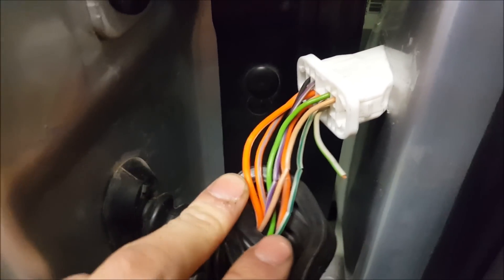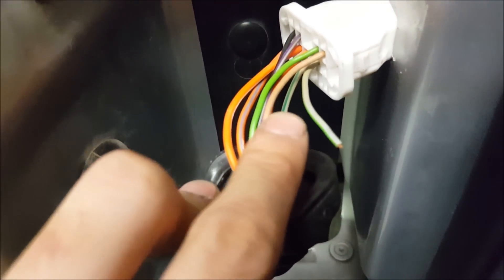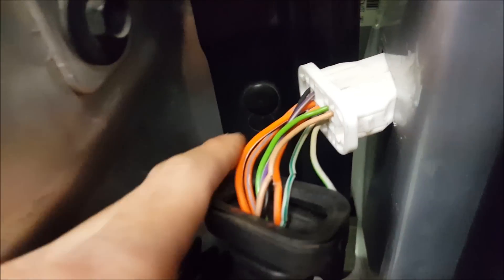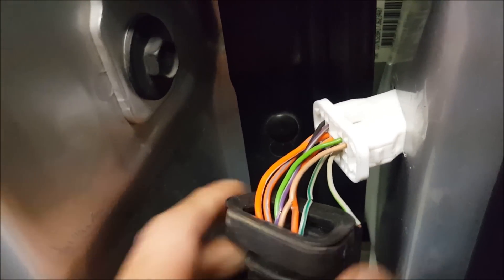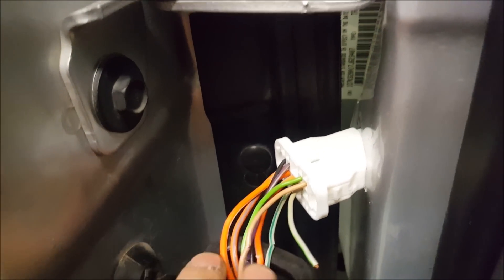This one is particularly bad compared to other trucks I've worked on. You can see these wires are breaking apart, so I'm going to have to repair all of them. I'll extend it a bit to give it more slack so this problem hopefully won't happen again. We're going to solder and shrink tube everything, but if you are losing operation in your left rear door you'll want to inspect the boot right away and have a professional shop repair it.